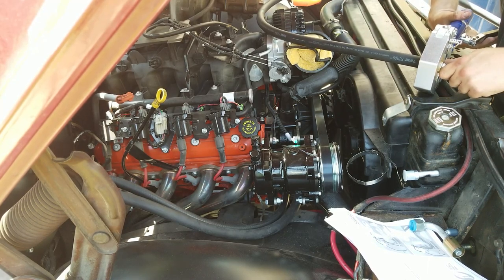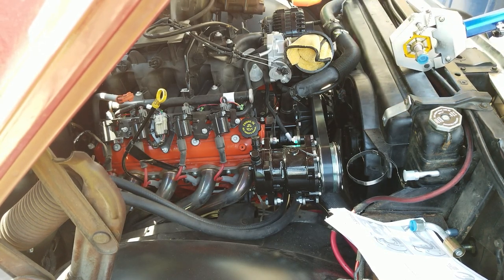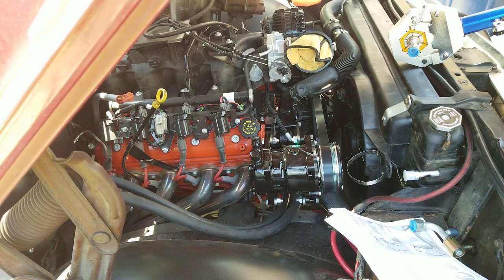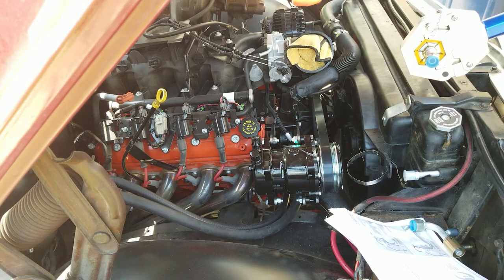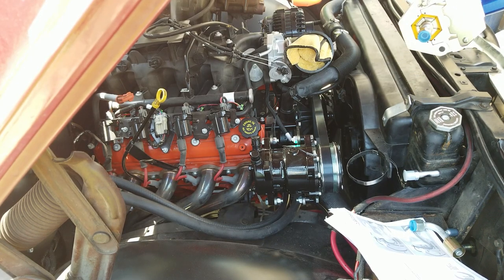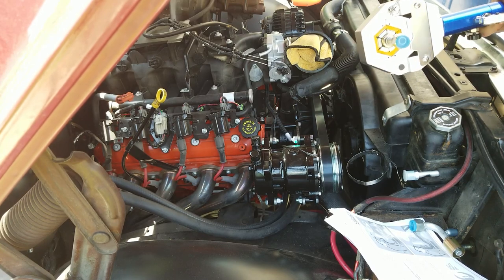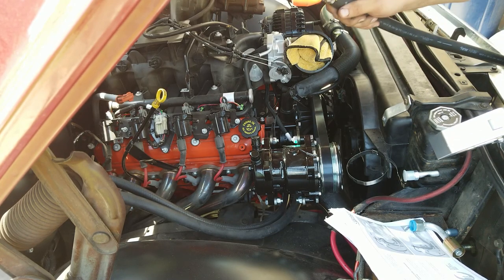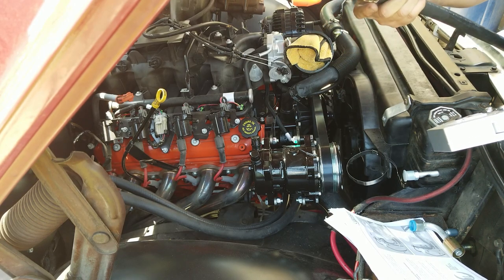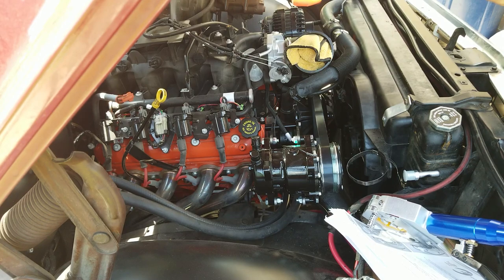I got the hose all the way in. I got the tool lined up kind of with the back of the fitting. And they basically said you're done when all the dies are touching. Like that. I mean, you can feel the hydraulic cylinder just stop when it's done. It's like using a press, you know when it's done. So I did put a little bit of a hook in it right there, but I mean, I crimped it. It's not coming off. It's very thoroughly squished.